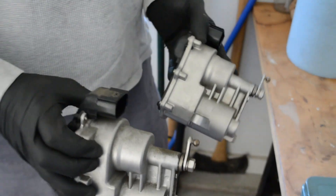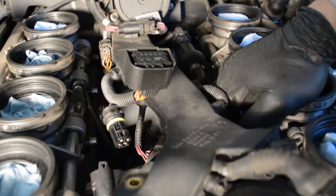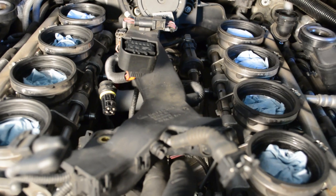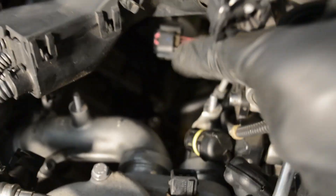So these are the two throttle actuators out of the car — they really weren't too bad to take out once we had the harness out of the way. One cautionary note: one of the throttle position sensors is on the bottom, and it clips up to the bottom. Take care that when you're lifting the harness out, you've already unclipped that or slid it out of its mount. The actuators are the same part, just flipped 180 degrees for each bank. There are two central mounting points and then two on each side — each actuator has three points.